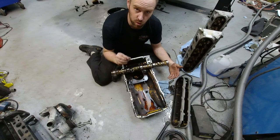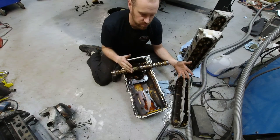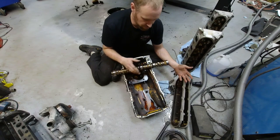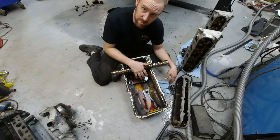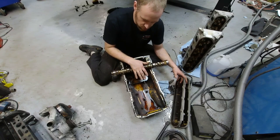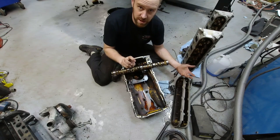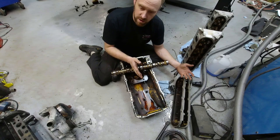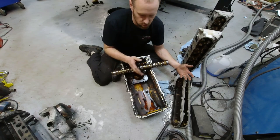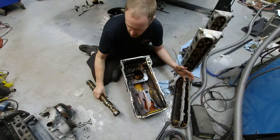If you have a little bit lower oil pressure than normal on these motors, that's generally okay because they have a high volume pump to begin with. As long as you don't have displacement on demand, you don't really have to worry too much about being under 30 psi. But the magic number is technically 27 at idle — if you start seeing at or under 30, you're getting very close to where your DOD is going to fail.